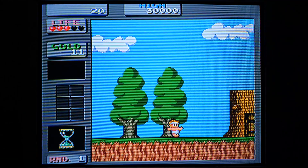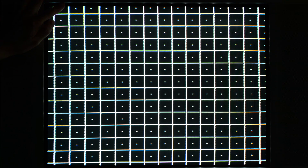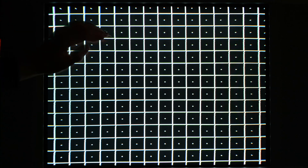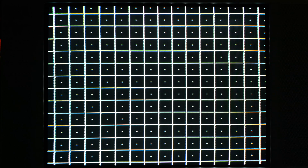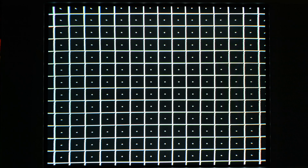I'm interested in convergence and geometry, so I've put up a crosshatch test pattern. There is a little bit of misconvergence to report: in the top-left corner there's some blue sticking out on the vertical lines, and a little bit of red in the top-right corner. The bottom corners are marginally better. There's also a slight crossover kink where the horizontal and vertical white lines intersect — a fairly common occurrence on many televisions. Overall it lacks a little squareness — it looks fairly square at a glance but there is some curvature.